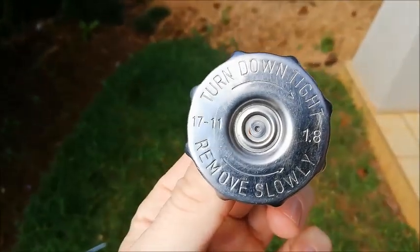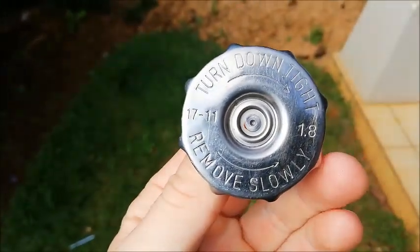With a good coolant, you're going to feel your fingertip actually starting to heat up. Straight away I can feel my fingertip start to heat up — that is the disbursement of heat just from my breath onto my finger. That is an effective coolant. If you don't feel any heating up once your finger is wet with coolant, that means your coolant isn't that effective and you have a quite low level of glycol inside it — not as effective as something with higher heat displacement.